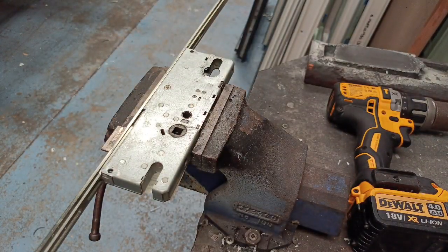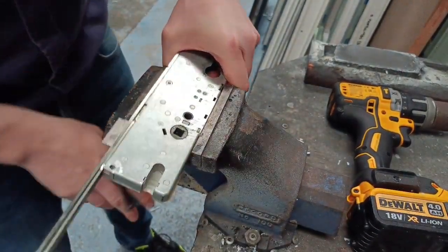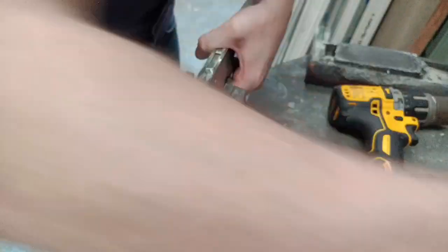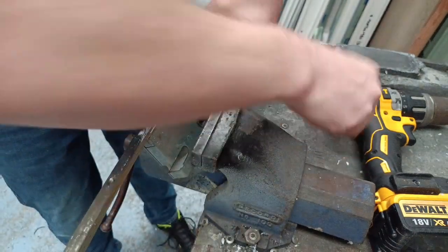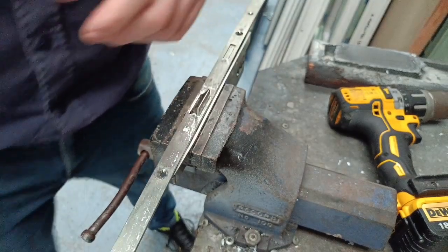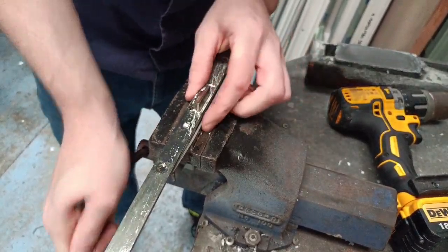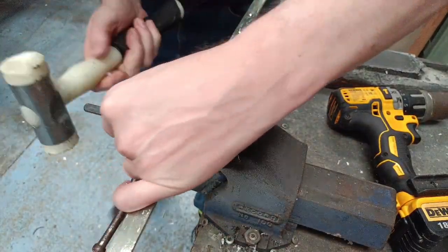We actually purchased original rivets — I'll put a link in the description. Position it under your gearbox and give it a spin. What I do is get a little piece of flat metal, pop in my rivets one at a time, then hold that piece of metal against there. Push it against the rivet against the gearbox. Then I use a punch into the opposite side of the rivet head just to widen it out.